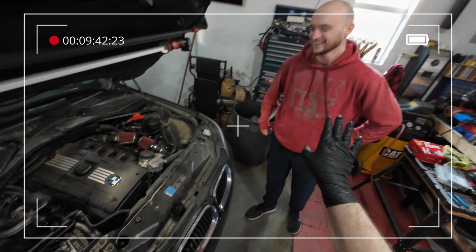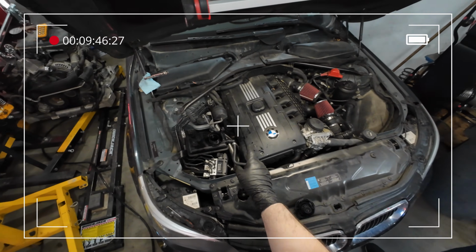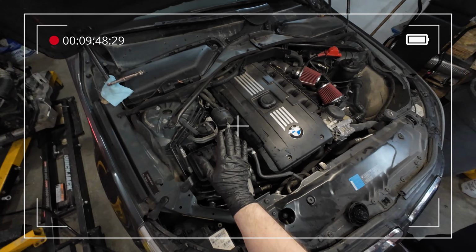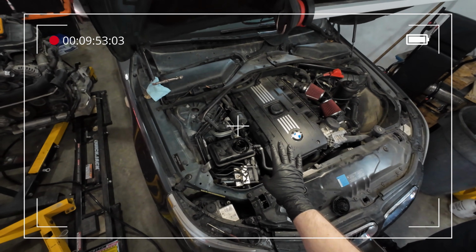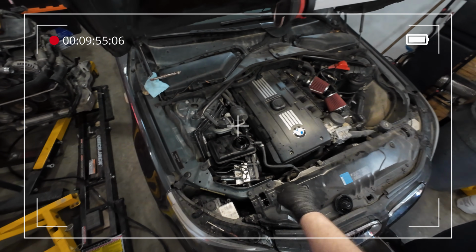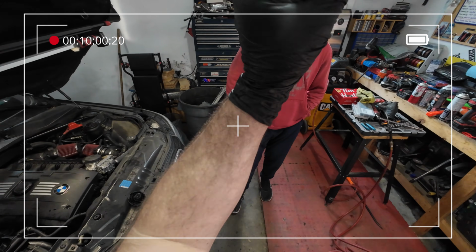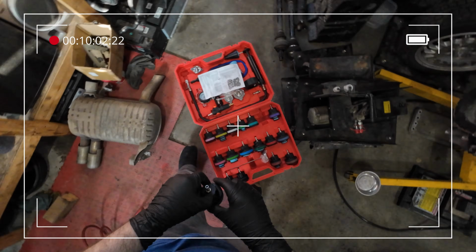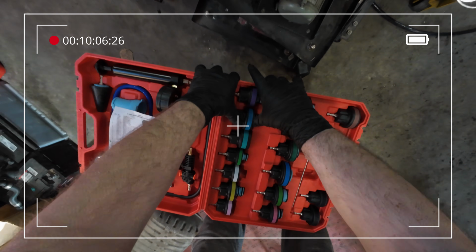Like to add context, his Forester, the hoses would get rock hard, and as a result, this would smell like exhaust gases. It was literally a cracked head gasket on a Subaru, which they love to do, pressurizing the coolant system, causing the problem. This would not have saved your car. No, my nose didn't lie for that one.